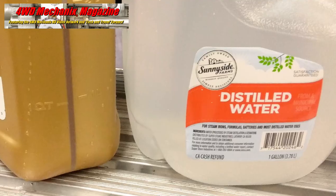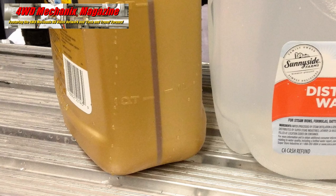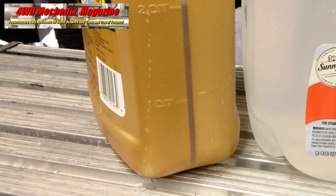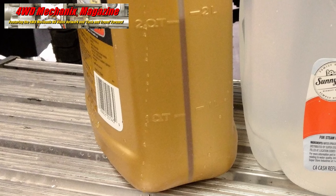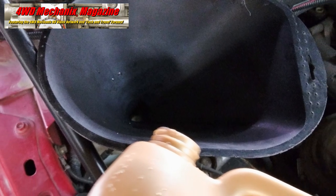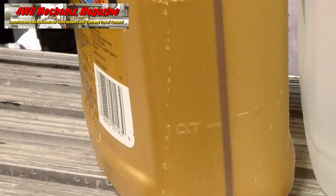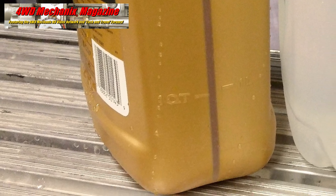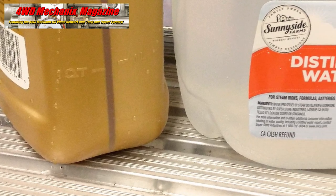For the coolant recovery tank, I mix 1 quart of coolant with 1 quart of distilled water. This way, the system has extra antifreeze toward the 60% concentration level. After running the engine for 10 miles and a cool down, coolant siphons into the radiator from the recovery tank. I fill the recovery tank again with another 50-50 mix. At that point, the 30-quart system has 18 quarts of concentrate and approximately 12 quarts of pure distilled water.